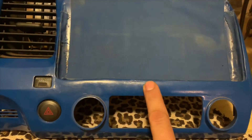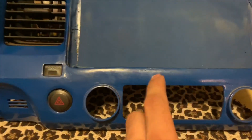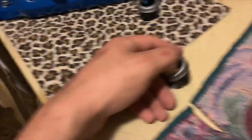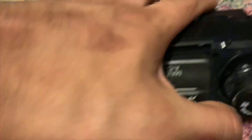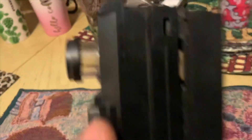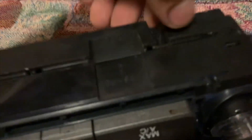For starters, you need to remove your radio dash trim. Once you remove all the screws around, you want to push down on the center tabs — these right here — just push down. These are little locking things that go on the top, so push down, and once you remove all the screws you're gonna have some little tabs right here.